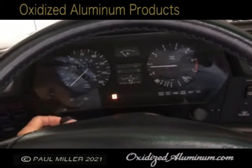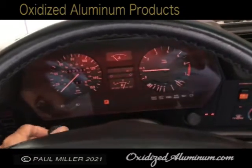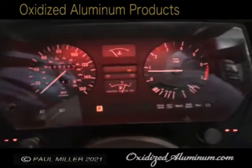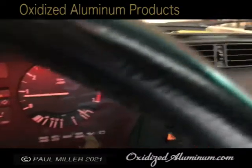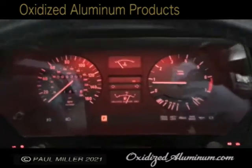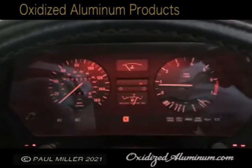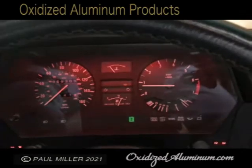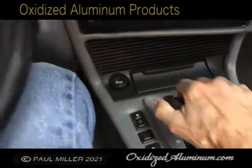Here's the instrument cluster. I put dimmable LEDs in here which really make a difference — driving at night you can really see what's going on. These older cars were always dim and it was always hard to see. So while in there I ended up changing that drive light, which was kind of major. You've got to drop the steering column, take the instrument cluster out, get the whole section for the new bulb put in, soldered, and put it all back together. So it's again $3 or $4 in parts and about $350 in labor, but it's worth it.